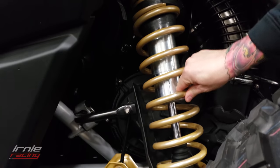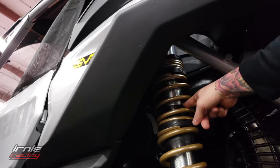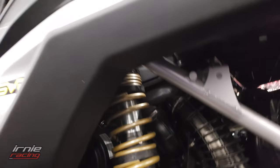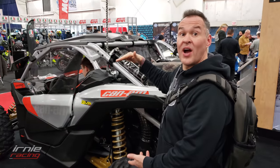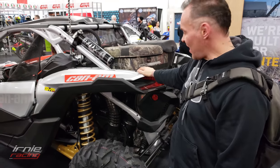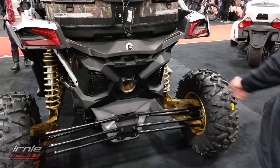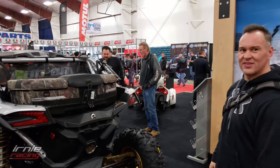So you got the big bump, small bump, with your locking pin, actual real locked in, which is cool, at 3.0. If you jack it up from the center, will this unload at all? Yeah, it will. That gives you the height. I said preload, but what I meant is the static sag versus loaded sag. Yeah, if it was hovering, it would extend. Exactly. So what do you guys think? It's pretty cool. And it's got three rear radius rods compared to two on the Polaris. Should we switch sports, get Rockstar sponsorship for this stuff? Oh yeah, for sure.